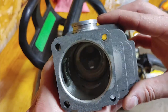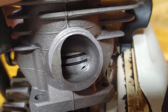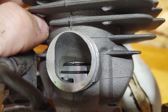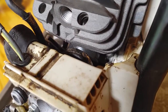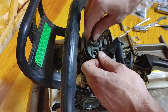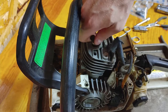Here I'm showing the new cylinder — I coated the inside with some two-stroke oil just for assembly purposes. This is looking in through the intake at the clocking pins for the rings on both the top and bottom rings, basically just verifying that they are where they're supposed to be and didn't get shifted over at all. Then I'm moving the old decompression valve over to the new cylinder, mainly so I don't drop anything in there while still putting everything together.